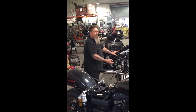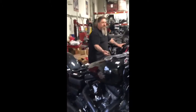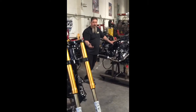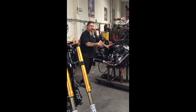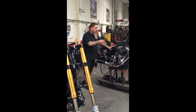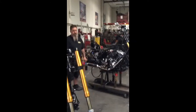All motors get the same horsepower at the top end. All you need is 2 straight pipes. There's no reversion at 6,000 RPM in a V-twin. There's no reversion after 4,000, as a matter of fact, because of the timing and the speed at which everything's moving. It cuts out reversion all by itself. But in that mid-range, from 1,500 or 2,000 RPM through to 4,000, that's where we want the performance. That's what this is all about. Nice.